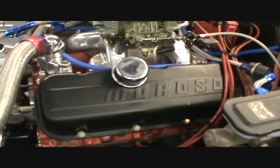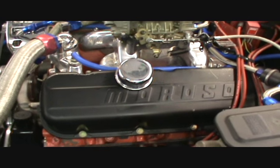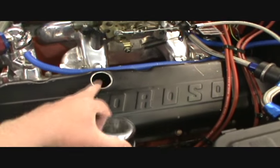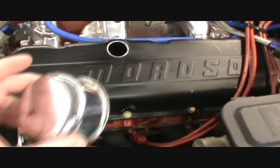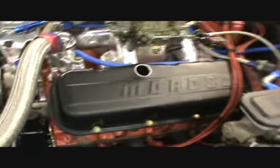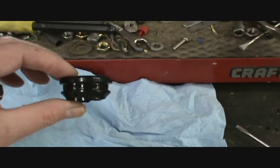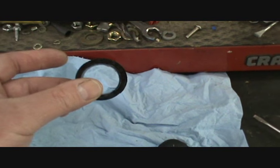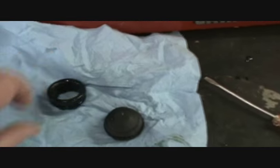I'm going to show you a little trick. Most people don't know what to do to keep the oil from coming out, but basically it's because the oil is being slung around inside the valve cover. A lot of people have the grommets down in here — I'm going to show you the grommet I've already pulled out. It's just a plain rubber grommet that they cut the end off and stuck back in the hole to put the breather in. This is what I took out — they just cut the whole bottom off so it's wide open, right above all your valve train, with oil squirting out. So of course it's going to have a tendency to build up in your push-in breather.